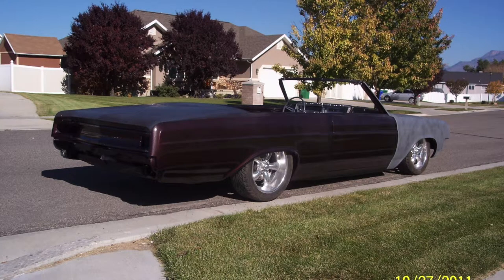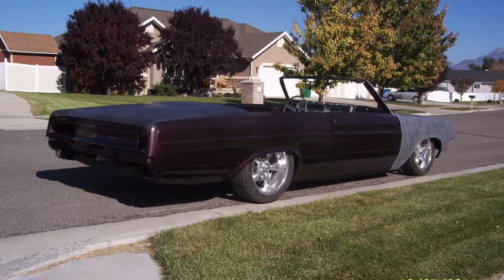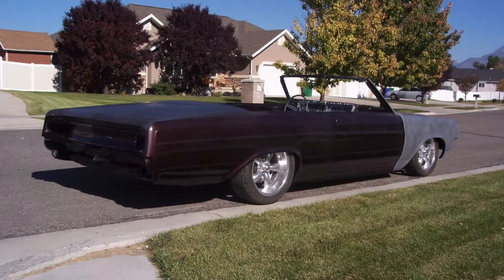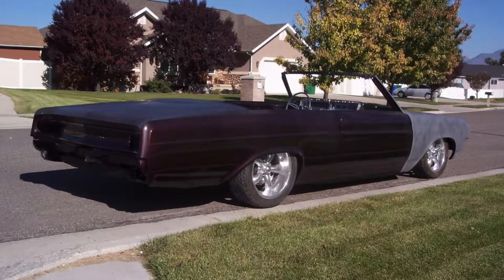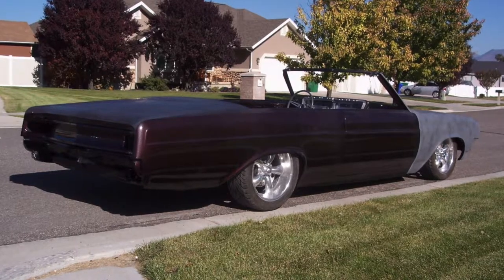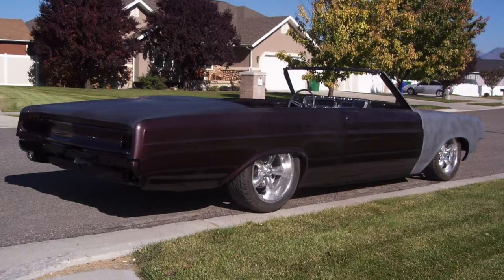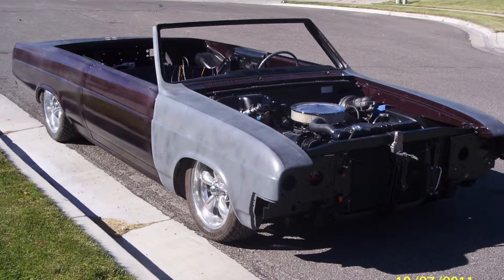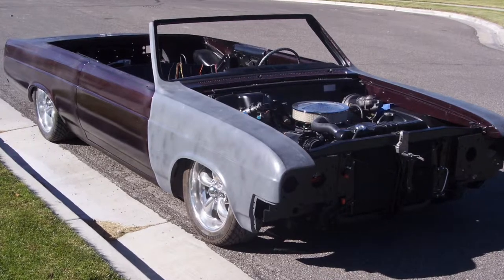The first time I painted the car, my plan was to paint all the back half — the body, the doors, the trunk lid, the jams — all at once, so there would be a seamless transition from the edges of the doors. Then I could put the front clip on, mask off the back half, and paint the front clip, trying to eliminate as much overspray as possible. Well, after that failed attempt ended up with all the metallics starting to settle in places on the car, we're back for another round.